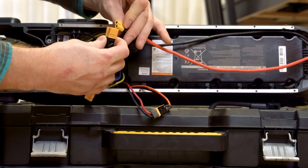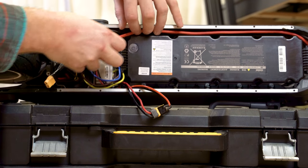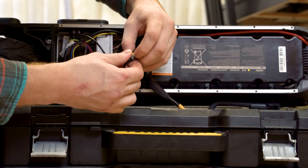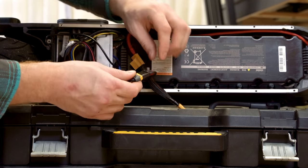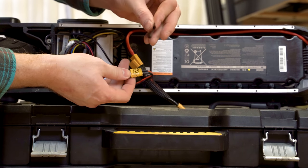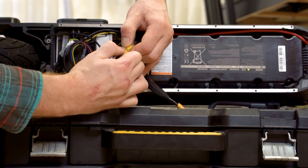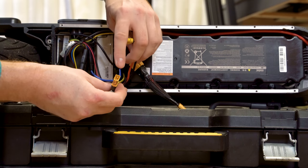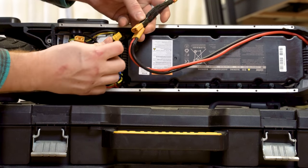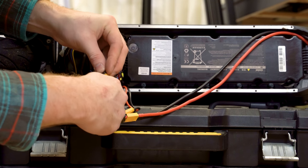We're coming in along nicely. This is the wire — the XT connector that comes out of the controller, and this end goes into the battery. What we need to do is take this included Y adapter — included with the kit from MyMaxMods — and clip it into the end of the wire that we threaded through the scooter. We take the XT connectors and plug it on in. It's pretty hard to mess up — there's a square end and a circle end on each side. Now we're going to unplug this XT connector that's connected from the factory. There's a little black sticker on it that prevents it from being pulled apart, so I'm taking the sticker off. Underneath it says 'void' — so you're voiding the manufacturer warranty by doing this. And we're unplugged.